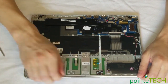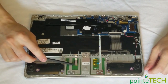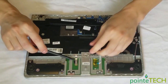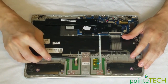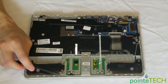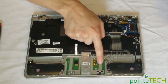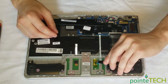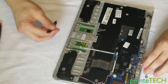There's your touchpad — there's the back side of it. We're going to try to get that out. You've got this little tin foil piece — as far as I know that controls static, so don't rip it off and lose it. We're going to try to save it. Slide a pry tool under there and roll it to get it out. And you've got this touchpad ribbon cable held on by tape so it can't come undone. I'm going to take the tape off but save it to put back on after. It's always better to do things well.